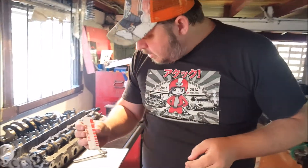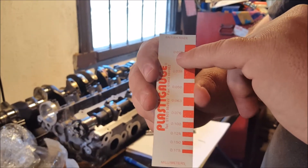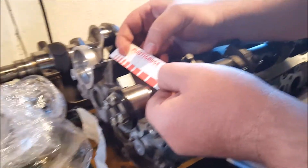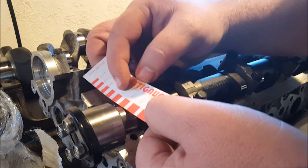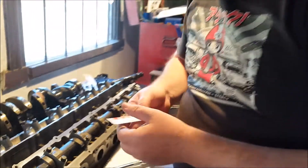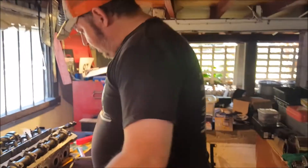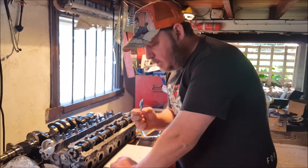Okay, so here's what we're looking at as far as the clearances. This gauge goes from 25 microns up to 175 microns and we compare the smear width to the markings. It's definitely smaller than the larger marks. It's about that - the smear on the thing is about the same as 63 microns, though there's no exact comparison. There's also thou markings on the other side - these measure from 1 to 7 thou. That's quite large and that's what I'm expecting - that they're too big.